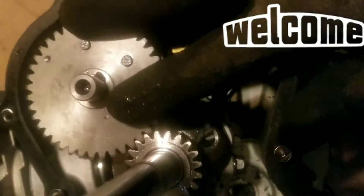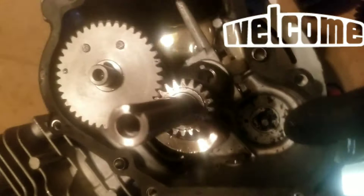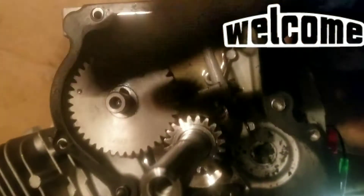I'm also going to have to check timing, and that's something you really need to watch out for. I really should have taken a picture as soon as I got the cover off so I could have seen the exact position of everything. Because in hammering this out, this moves — it comes up a little bit and moves. This timing is more than likely off. So if you're removing a governor, make sure you keep an eye on this, or you're going to have startup issues and your timing is just going to be off.